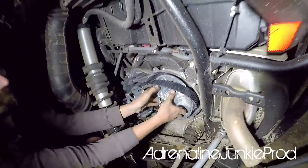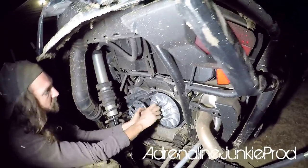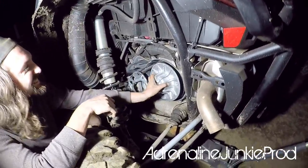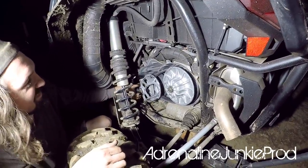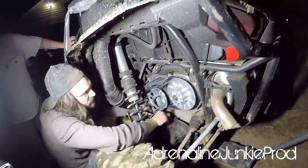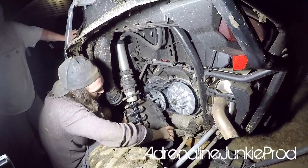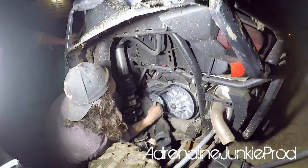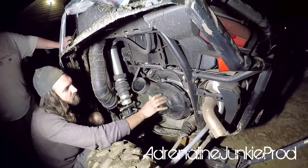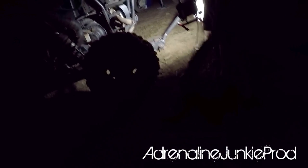As you just witnessed, replacing a belt is pretty easy on our Polaris Razor. It's something you can easily do on the trail with just one special tool and an 8mm ratchet to get the belt cover off. One of the worst parts of this job is finessing the cover off the clutches and putting it back on. At home in the garage, the easiest way is to undo the lower shock bolt so you have tons of room. When snugging the 8mm bolts on the CVT case, make sure everything's aligned, the seal's in the right place, and don't over-tighten — it's just plastic.